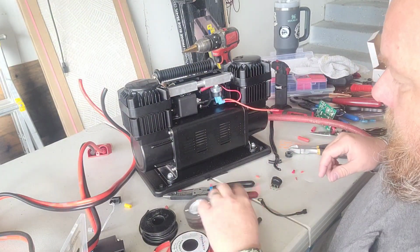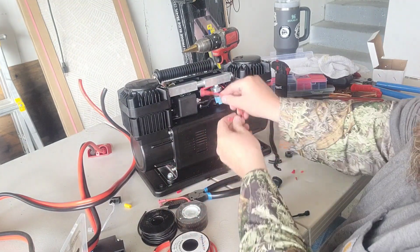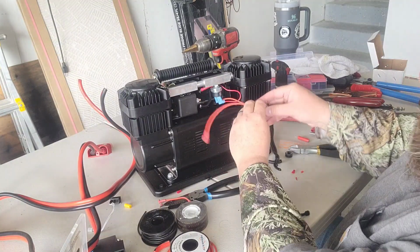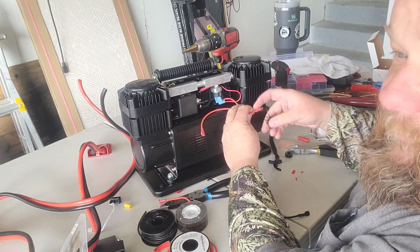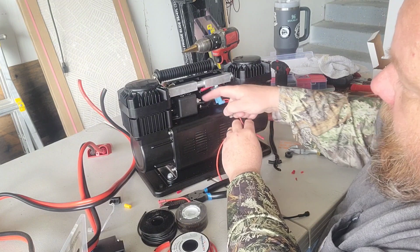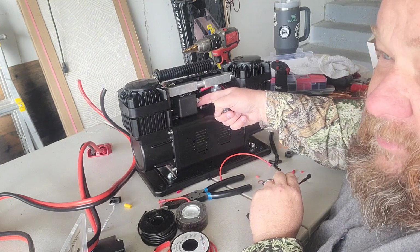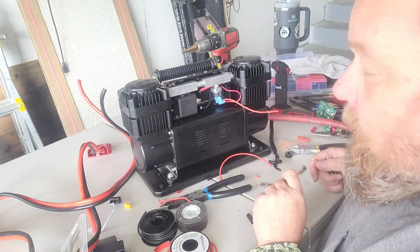And I did a little bit of wiring here. Also built a wire that's going to go from our relay to our switch, from our switch to our pressure switch, from our pressure switch down to our thermal lead. So that's what all these red wires are. It's just our power circuit, if you will, since we have a couple of different switches in line. And then our ground circuit will be simply that little guy that jumps from the ground terminal to activate the relay up to the ground terminal of the relay so that we have a ground.